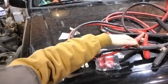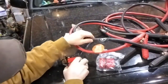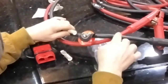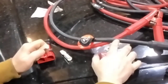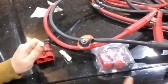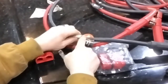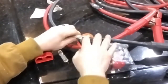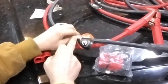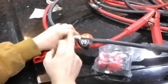The plan is I'm going to measure back about 12 inches and then install these. Some people solder these onto the cable, but you do not want to do that with a jumper cable. I'm not a big fan of soldering on anything because if that wire gets hot enough to melt solder, you should probably smell it first, but then the wire can fall out. If you're going to solder it, I would at least crimp it first and make sure it's crimped on the wire before soldering. But I'm just going to crimp these.